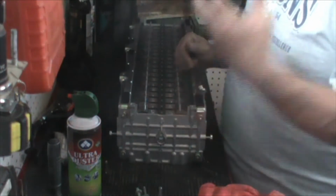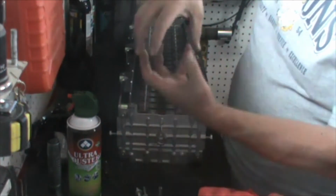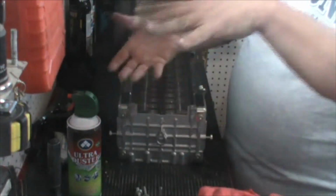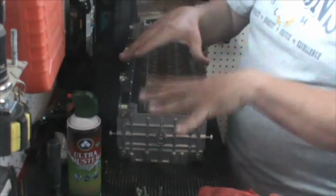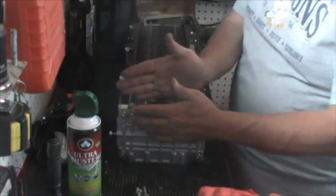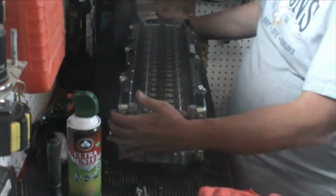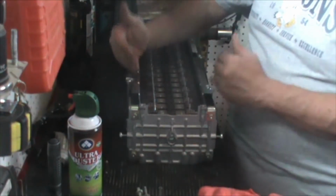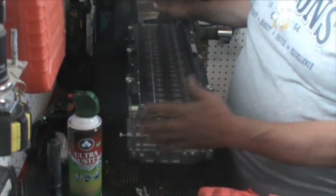So, do all batteries need compression bars? Cylindrical batteries, such as the 18650, tend to expand and contract linearly. They tend to elongate rather than get fatter. So, having plates on the top of them, that's why they have these huge plastic plates over the professional ones, is to basically manage that mechanical energy. But whenever we have battery packs that are basically lateral, or linear, you see that battery manufacturers have complete systems such as this CMAX one, usually comprised of metal.